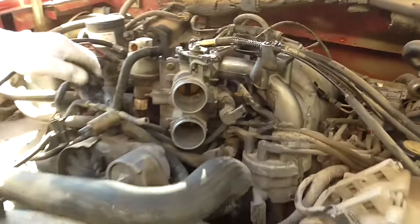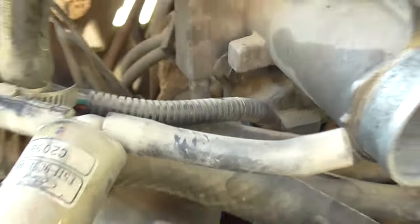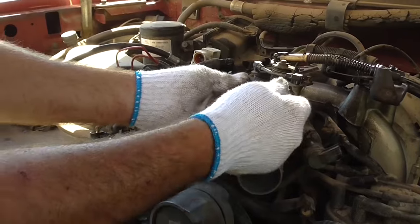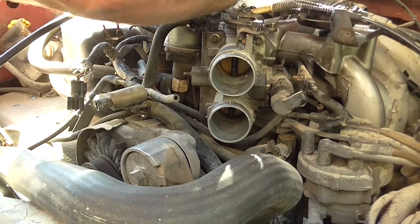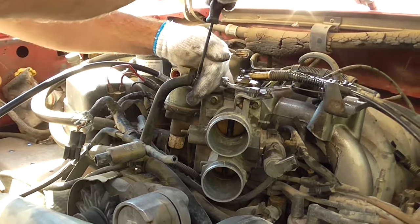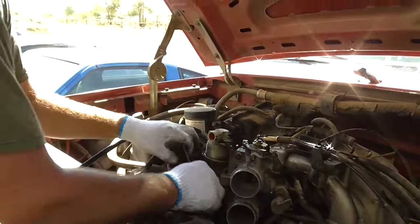Here's where the throttle position sensor actually is — six o'clock position. Because wherever the throttle is, directly across is the throttle position sensor. Here's the plug for it. You have to take this cooling line off too. They put cooling lines inside the throttle bodies. Get this out of the way — if it'll go without busting. These like to be stubborn, but once you get the clamp off, usually the line comes off with a little bit of coolant.